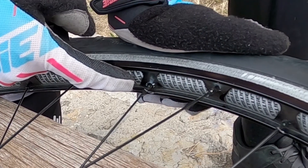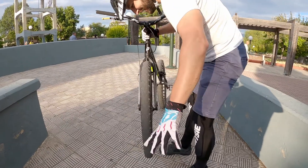The relevant nipple holes were cracked. Cracking the rim wall means it's impossible to straighten this wheel just by tightening the spoke nipples, as the cracked nipple holes are unable to withstand the tension of the spokes. Also, the principle regarding equal spoke tension for each side of the wheel is applicable only when the rim is relatively straight when untensioned. In my case the rim is seriously buckled, and even if the nipple holes could withstand the required tension, the spoke tension would be so unbalanced it could potentially cause damage to my hub.